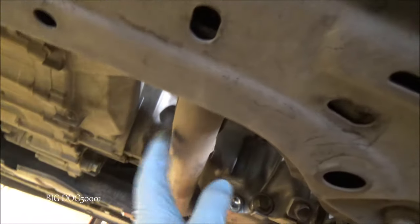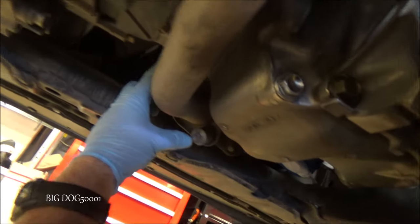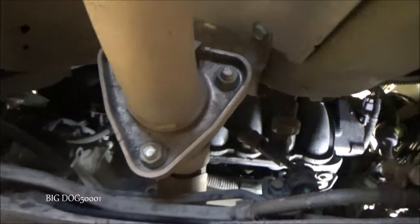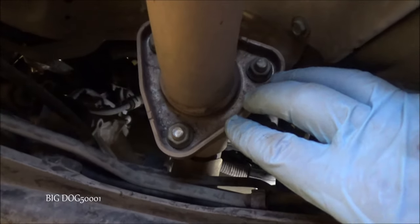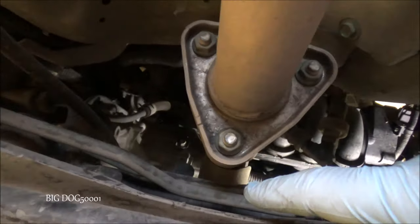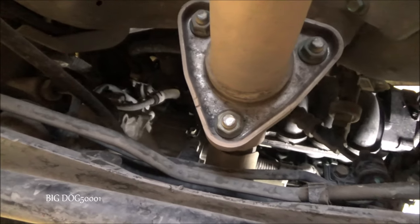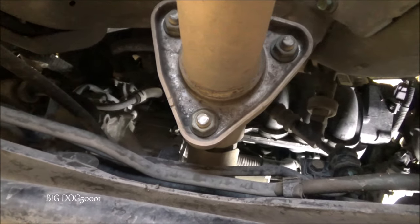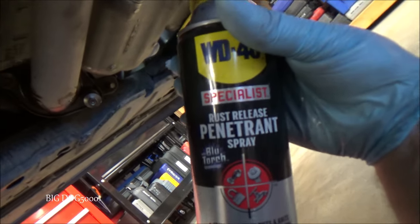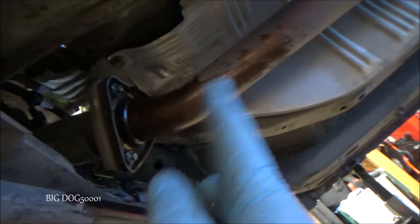To make a little more room we're going to have to pop the A-pipe off, so we need to remove these two bolts and the three nuts. Now, I live in the desert so there's no rust, but if you live in a rusty area you'll probably have to heat these up and may even have to cut them off with a torch. If that's the case, you might want to consider pulling the axle out instead. I hosed everything down with some rust penetrant.